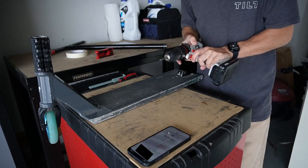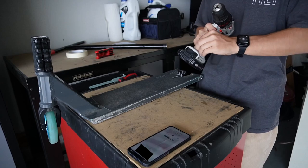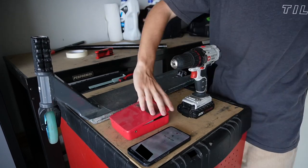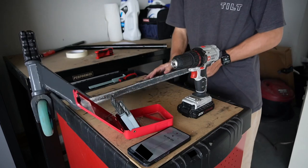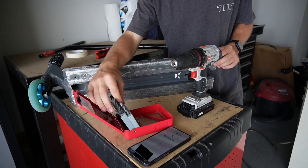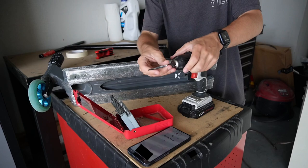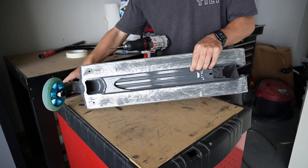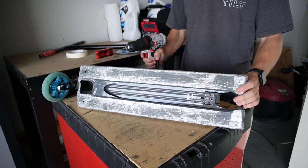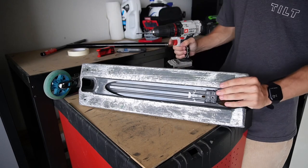You're going to grab a drill. Take out the Phillips bit because you don't need that, and then get out whatever drill bits you have. Find a drill bit that closely matches the size of the axle, just a little bit smaller. For me, I think this one might be good. Put that inside of the drill, set the scooter up on its side, and drill right through the center of the axle. You're going to drill literally right through the axle. So let's get into this.